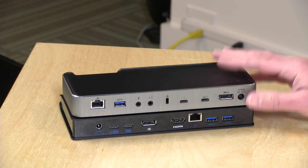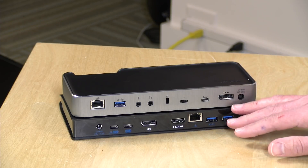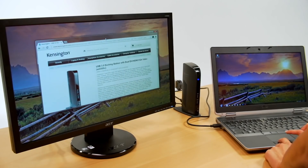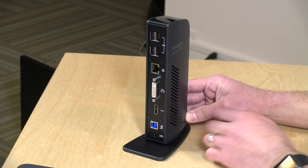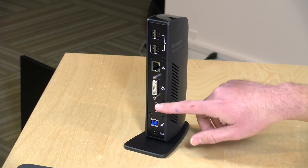We're going to do separate videos on each of these docks with a deeper look at individual features. But just know that if you've got a Thunderbolt computer, the Thunderbolt dock is the best option. If you're using one of these USB 3 docks on an older computer, there are a couple of things to keep in mind. First, these docks do not provide power delivery to your laptop — you still need to plug it into the wall with its power adapter. Second, the video output runs through a special driver called DisplayLink that you'll have to install on your computer. It adds a little overhead — I've seen it run on PCs costing $200 or less without issues — but you do need that driver installed first to make use of these ports.